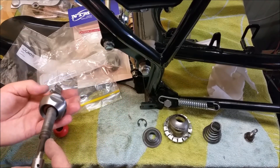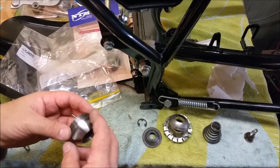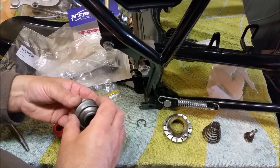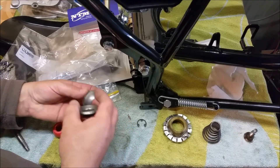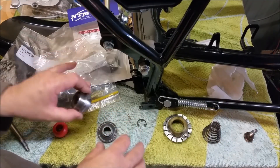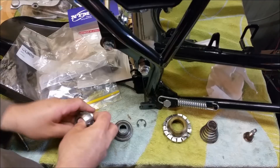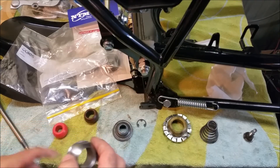What do you think? I think the first thing to do regardless is to run this thread into the housing on the gearbox just to make sure it starts nicely, because there's going to be resistance when you put that in. As far as the assembly goes — that sits on top, then that goes there, so that's the way it goes. Whether we use that or not — I don't know. I'm assuming we have to use that on here as well. Whatever the case, if it does make the height too much, it's just going to put more pressure on the spring, which means the reverse detent will be better. So I might put that on there, then the spring, then the rest of the assembly.